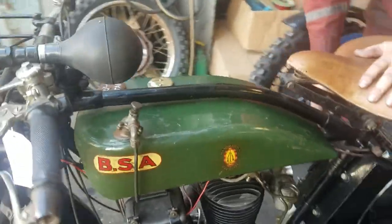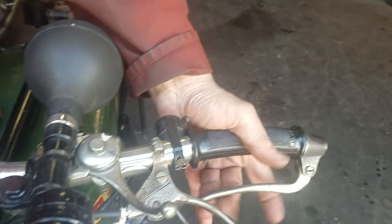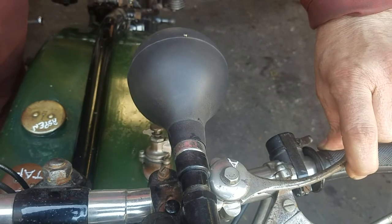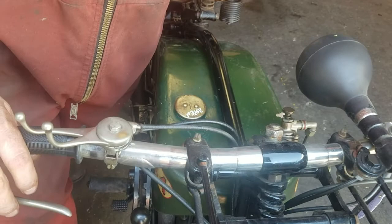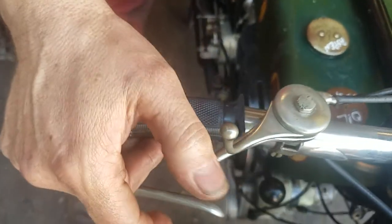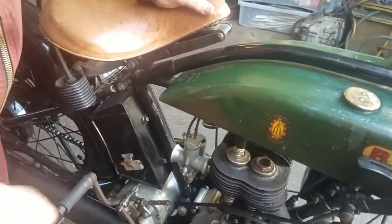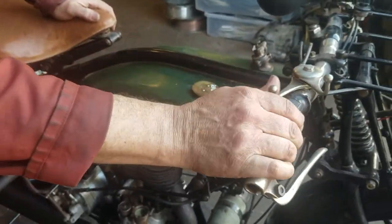Tickle it up. Going to go to the controls. Valve lifter is this one — I'll capture that. Clutch. Advanced and retard: pulled back to you is advanced, so that's full advance, and that's retarded — about there. This one is choke, this one is the throttle. Choke off there, and on there. Because it's got a later type Amal carburettor fitted to it, which makes it more rideable.